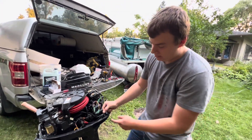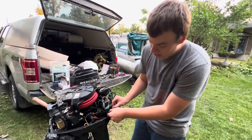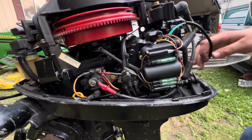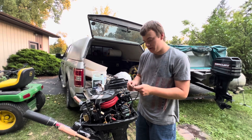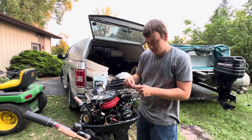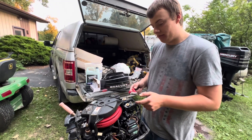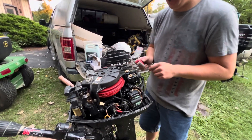Next I'm going to start snapping all the wires into the little clips, starting with the longest one and working our way down. Now I'll attach the wires for the coils — the yellow striped one goes to the left, and then the green and white go to the right. I got the two bolts off, and I'm just going to go around with this little wire brush and make sure that the contacts are clean.